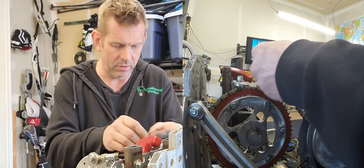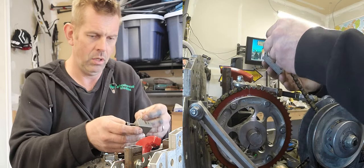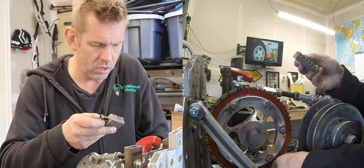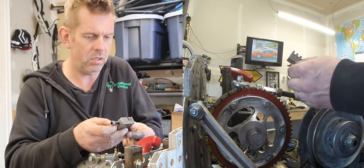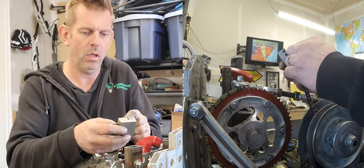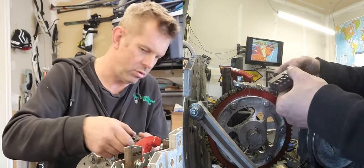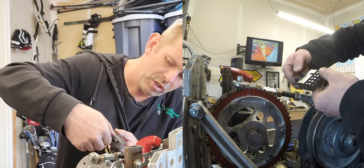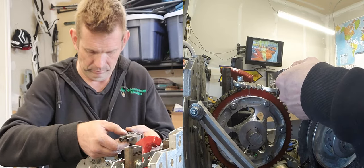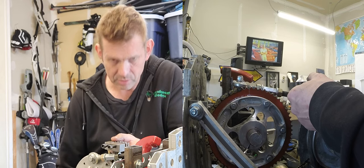So I'll put that back together. I'm going to use the chain breaker in the opposite way. We've got the pin still in there — we'll back off the screw. This is the pushing-it-back-in screw, and there's the pin. I just lost my pliers there. Now the half link is going to go in there like this.